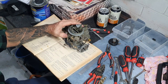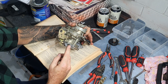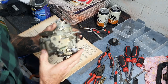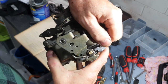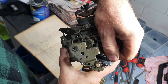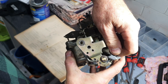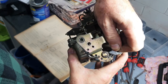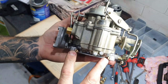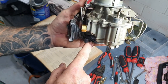The only other things you've got to do are once it's actually on the car. Your slow idle screw is backed off — you can see there's a gap there. When you get it on the car, turn that screw until you reach the desired idle speed. For an automatic I'd guess around 700 to 750 RPM. Once you get that running, come back to these two mixture screws down here — they're at one and a half turns out.